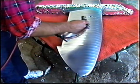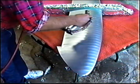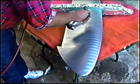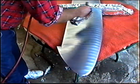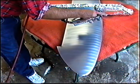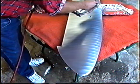Silver shows up every mistake. Mistakes you'll never see in the final coat. Where I used rejuvenator on any of those spots, what I'll try to do is go back over them. I see one right here, and give that a few extra coats just to let that soak in, get a good bond. Any spots that look like they're going to need some more sanding, just bury them in paint. Use the silver as a filler.